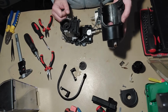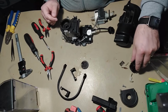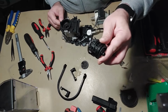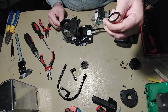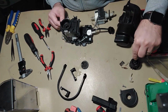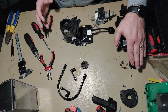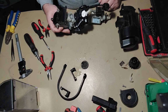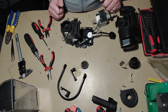The most leakage that I saw is due to clogged nozzles, clogged diffuser plate, or this O-ring getting bad from the cup. I don't know how to call this. The not cup holder, cup puncher. Let's call it like that. So yeah, these are the hot leaking problems, and this. And this U shape, it's the cold leaking problems.